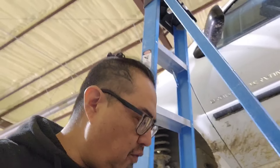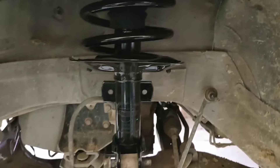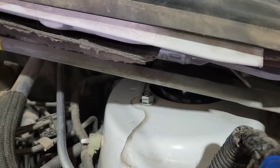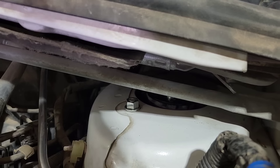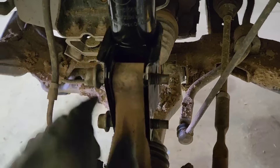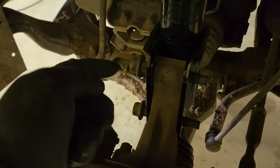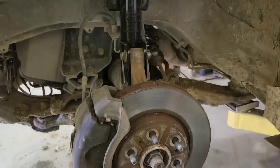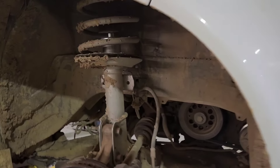The owner is picking up some more parts right now. When the old strut was hanging on, only one bolt was hand tightened holding it on. When I took everything off, I picked up the strut underneath, took that nut off by hand, and placed the old strut down. Then I grabbed the new one, slid it up in there - it slid in no problems. I hand tightened the nut, picked up the knuckle, and put the bolts in. Now I'll put the nut on and as I tighten those up it will pull them through. This one's ready to go, I just got to put the wheel back on.